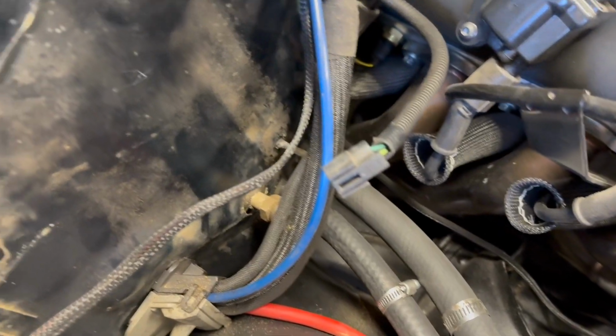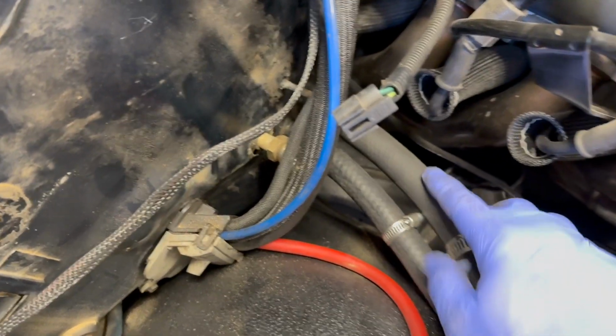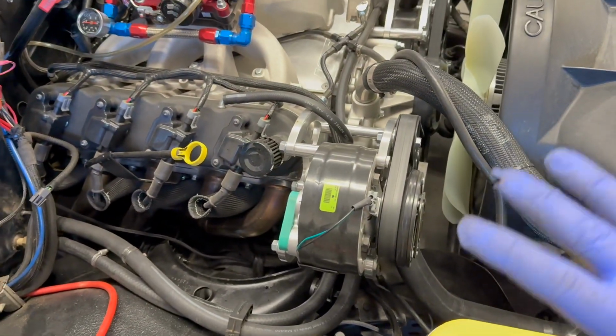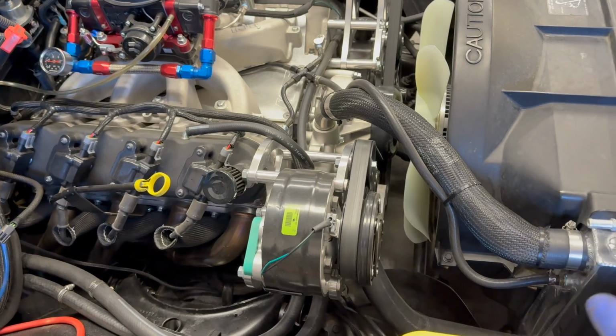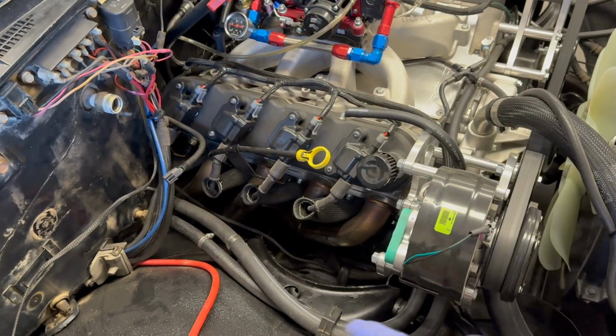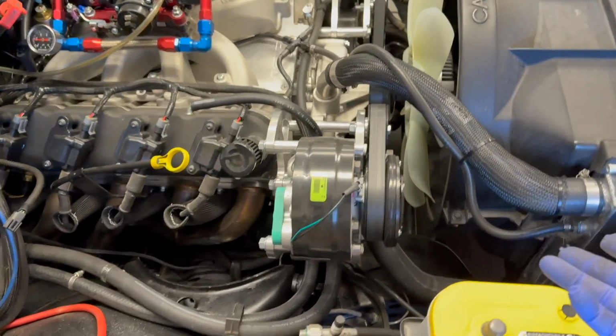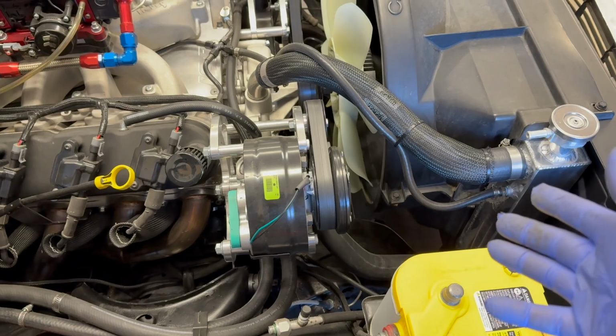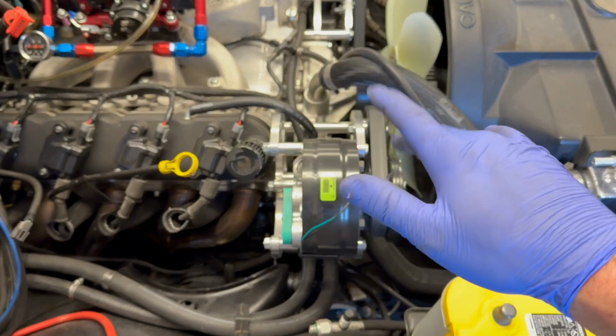Here's that pro tip coming back to pay itself off. These heater hoses that go to the water pump, remember whenever I filled the system to test it, it just has distilled water in it, no coolant. Because I knew that, well, first of all, if you find a leak, you don't want it to be leaking $20 a gallon coolant. And so that's kind of a nice test.